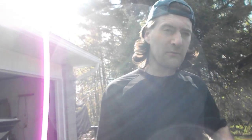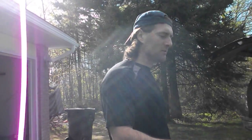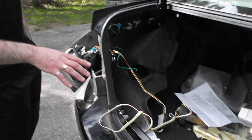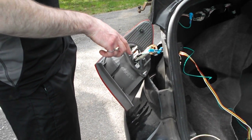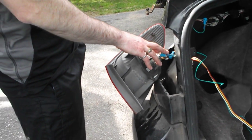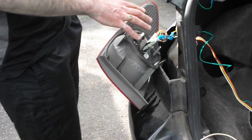So that's how you install and check the wiring for a 2007 Toyota Corolla. If you have a different vehicle, everything I told you is identical except you'll need to probe out the wiring on your wire harness using a voltmeter as it plugs into the light fixture sockets. Just identify which wire is the right turn, left turn, brake, running lights, and ground — then drill it on the frame. Good luck with your project.